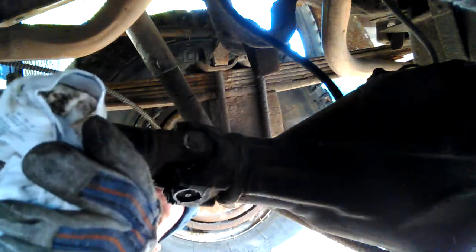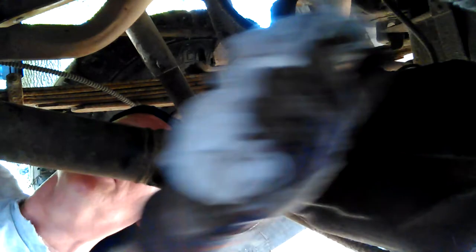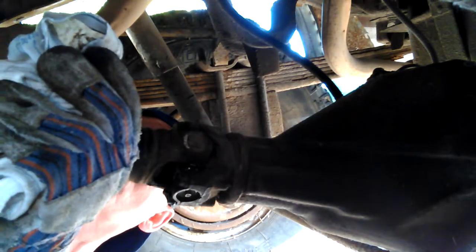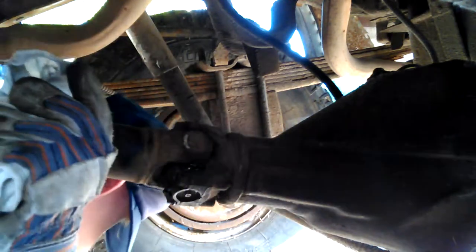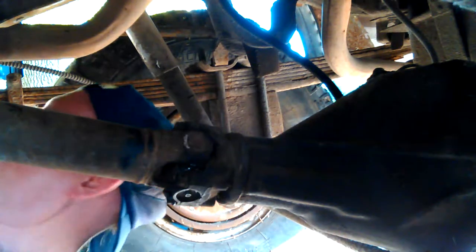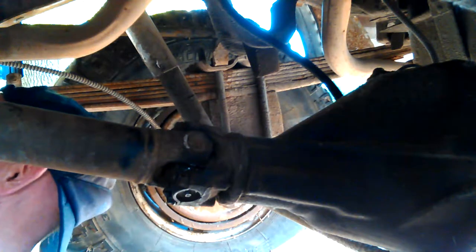They really don't move too much before they all of a sudden let go. This thing being jacked up, it's got aftermarket springs and there's a block — about four inches on the front, about six on the back, it's an angle block. There's a lift on the back, and I didn't think there's a block in the front, but it sits level. It does have aftermarket springs on the front — I bought bushings for the front end springs years ago and put them on, and the stock ones wouldn't fit.